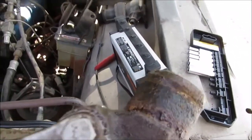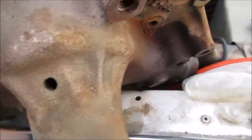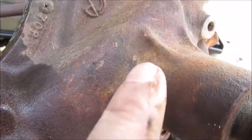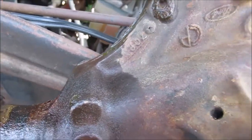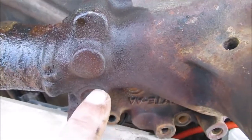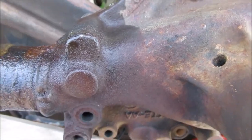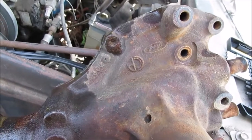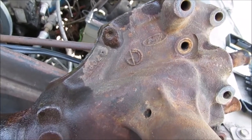It's not leaking out of the weep hole. A water pump has a hole — the lines will show you. See that hole on the top, turn it around, see the hole on the bottom. It felt dry when I took the pulley off, so I knew it had to be leaking out of the gasket. That gunk on it is just PB Blaster we sprayed alongside the bolts. That's it for this episode — I might show one more clip as I'm putting it back together, but thanks for watching.